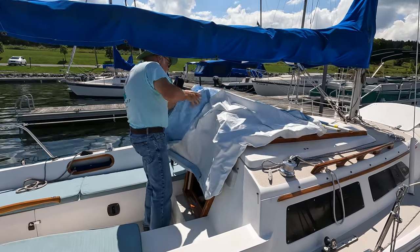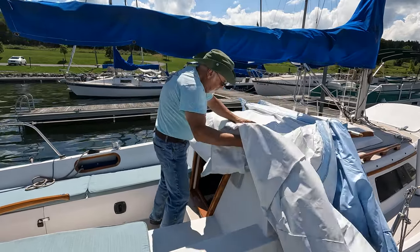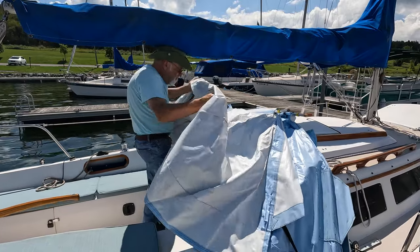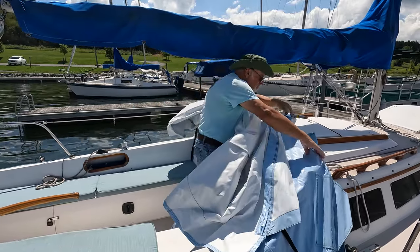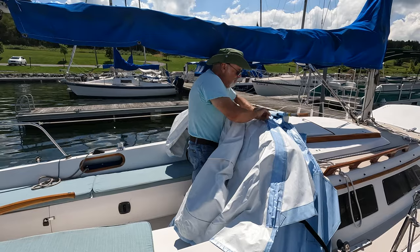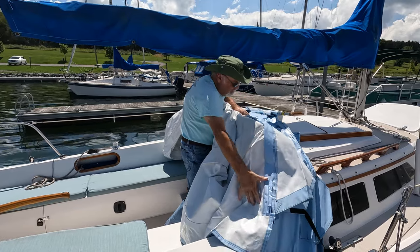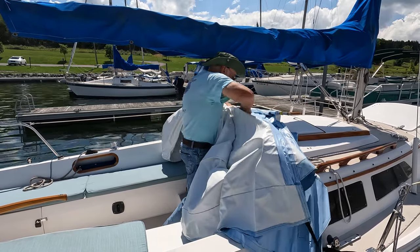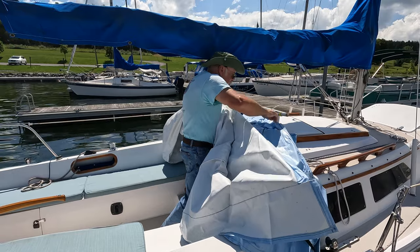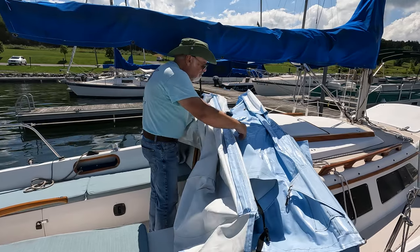So I made it wide, the full width of the boat, to help keep the lower setting sun from shining too far into the cockpit. Also, to keep it high so one could move around underneath. To give it support from gunwale to gunwale, I used expandable paint roller handles from Lowe's that slide into pockets on each side of the awning and support it totally up by using the full length of the boom. These long handles collapse to less than 4 feet for the whole cover and supports to fit into a 4-foot by 1-foot zippered bag for storage.